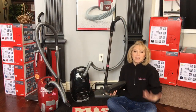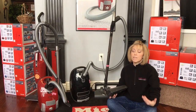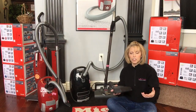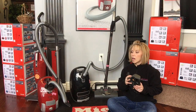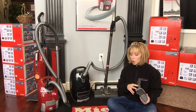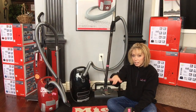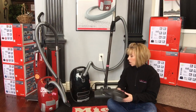Because the turbo is a weaker driving system, when carpet pile gets too long or shaggy there's too much resistance — the brush roller will slow down, keep slowing down, and eventually stop turning altogether. It's also affected by the vacuum's suction level; turn it up or down and the turbo speeds up or slows down. As you move over different kinds of rugs, you'll hear, feel, and see it losing performance. Long story short: turbo nozzles are remarkable for what they are — on a low pile, smooth rug you'll get much better pickup than just a smooth gliding rug tool — but there is a massive performance difference between a turbo and an electric power nozzle.